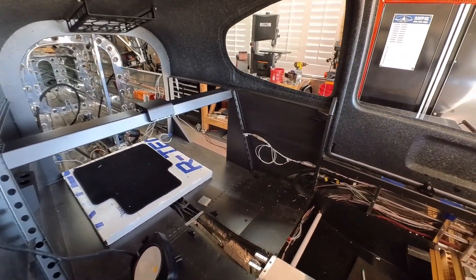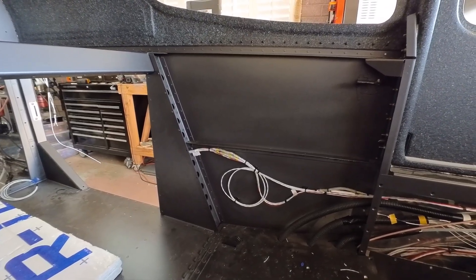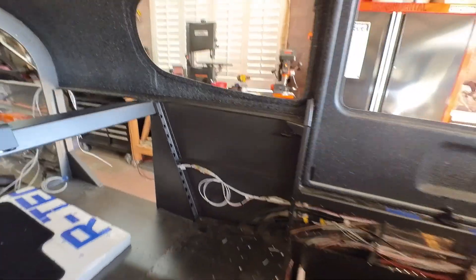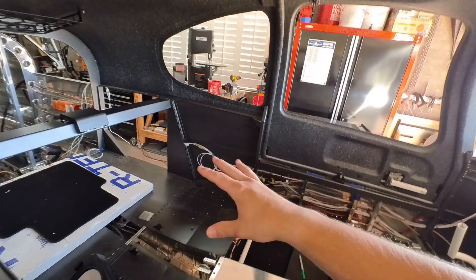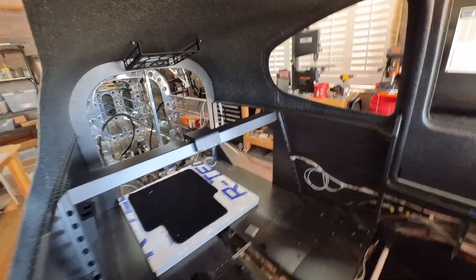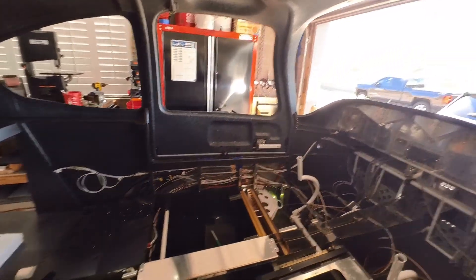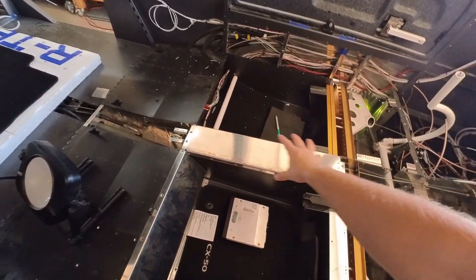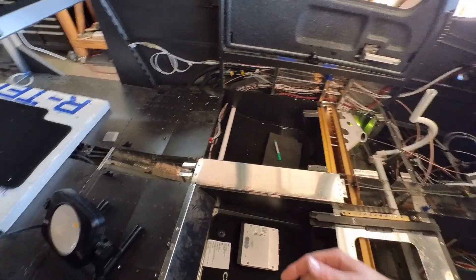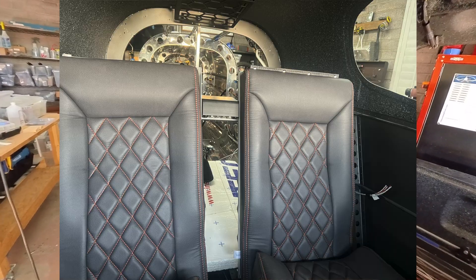I did splice them and used solder sleeves on the internal wires. On the outside, I used quarter-inch copper shielding tape from Aircraft Spruce and also solder sleeved that on. This should work totally fine, but I do understand the risk of adding extra joints. A more seamless installation would have been to not have them come with the installed headset jack heads and just do all the soldering myself. If you are doing a center console setup, you should be able to just run those wires straight back — you're not going through tiny little grommets in the side.